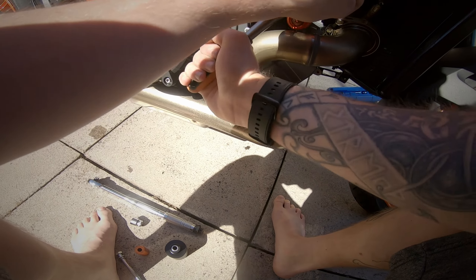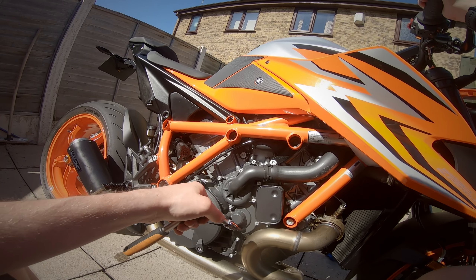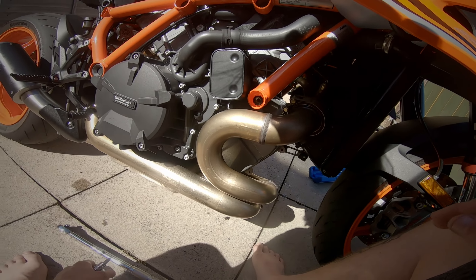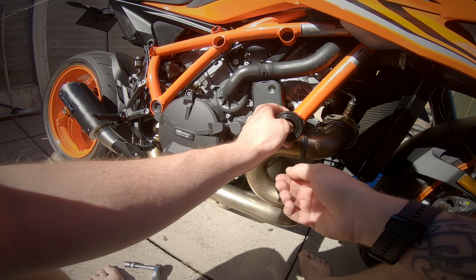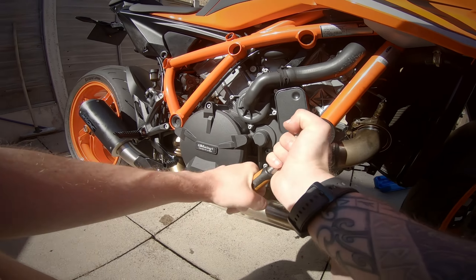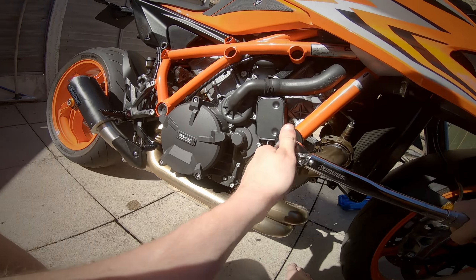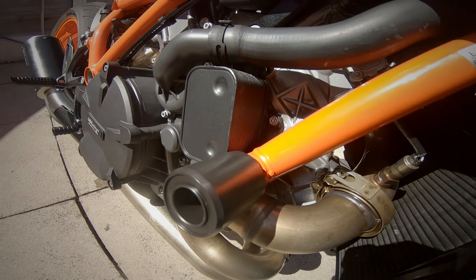Just be a little bit careful — it is on an angle so you might want to tip it up and be very careful when doing this. Come on now — oh, it's warm! Just be very careful, it's very hot. So again: puck, lock washer, washer, bolt through, collar. No particular torque yet, just to get it located first. As it starts to nip up, get back onto your torque wrench so we don't over-tighten it. There we go — 40 Newton metres! And there you go, all done. They look good!